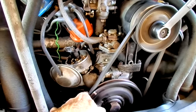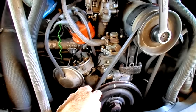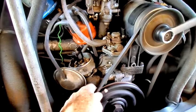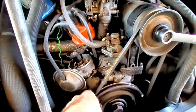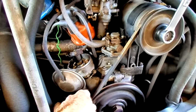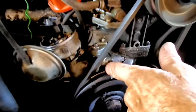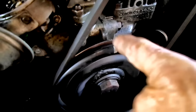A lot of heat is dissipated, especially in the exhaust valves on air-cooled motors, so valve adjustment is very critical. The play and the gap is very critical. I'm bringing it around to cylinder number one. Here comes our timing mark — you got a little notch in the crank pulley there, that's your main one. You bring that right up to the split in the case.